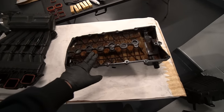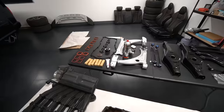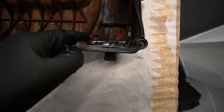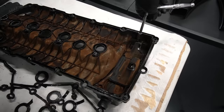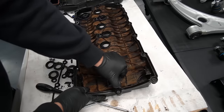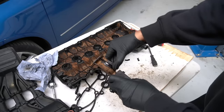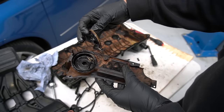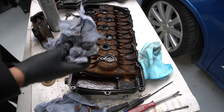Moving back to the table — we've still got the rocker cover gasket in place. I was going to say it's quite brittle but it literally snapped rather than bending. Now, changing out the PCV diaphragm from eBay — it's not straight away apparent but on closer inspection there are a few little screws holding it in place. That PCV system is due a change — it's a bit of an understatement because it's not really rubber anymore. There's so much gunk on the screws you'd think there's no thread, but there is. It looks like an absolute mess — legit looks like vomit. I just touched it and it teared. Not damaged but it probably would have eventually. Transfer over the spring and the new one is a lot more supple — eBay PCV diaphragm in.